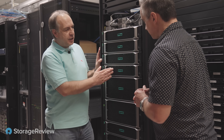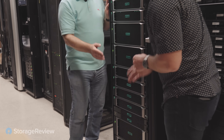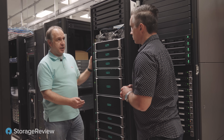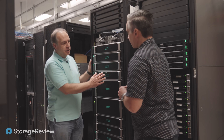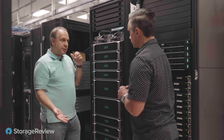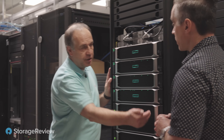Eight total controllers. The smaller ones here are our drive bays — four up here and four down here. And then there are two 1U units down here, which are the cross-connect switches. That's all of your controllers talking to all of your drive bays. This connects all the drive bays to all the controller chassis. In a maximum build-out, we can do six controller chassis with up to 12 controllers in a second rack, and they connect to the same cross-connect switches on the back of the rack.